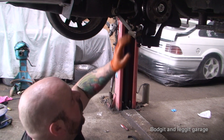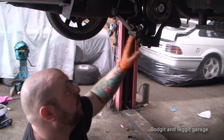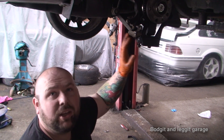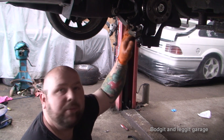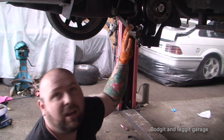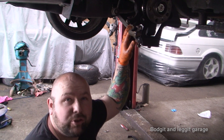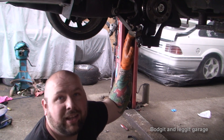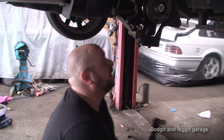Them six bolts are now tightened. If you want to know how we got to this area, watch the first video on the front brakes and the CV joint — that'll explain how all this is off. There is adjustment for the camber here — you have to get this tracked. Even if you can line up with the old marks, get it tracked. I don't show tracking because not everyone's going to have tracking gauges at home. Even if the car feels good, believe me — just get it tracked. You can do all this work, go down to your local garage and get them to track it, and you'll still save yourself a fortune.